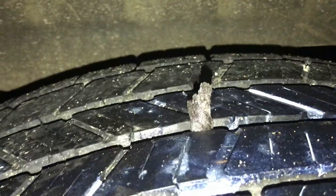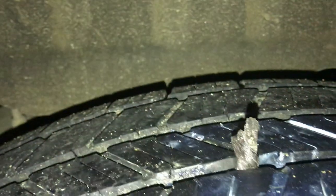Done. Now we don't know if it's leaking yet, so we'll put air in it. I have some sealant I'll put around the edge. Now the test: we'll fill it up to the correct PSI — these tires take 35 to 40 pounds. It's dark so I've got a light shining on it. Let's see if this plug holds. If it does, you've got a $14 investment in the tire kit, and you can fix a tire for under five dollars.